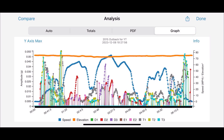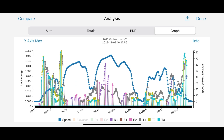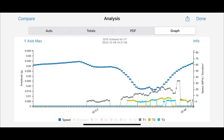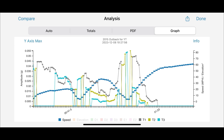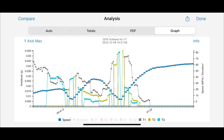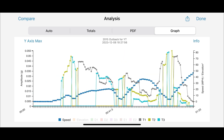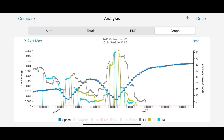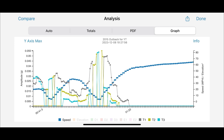If we rotate the phone sideways we can look at a graph. I like to deselect elevation, deselect the drivetrain, and deselect the engine — D and E stand for those — so I'm only looking at tires. Looking at the blue line which is our speed, you can definitely see the vibration increases as speed increases. It was even catching vibrations at 20 miles an hour, even though the customer said they could only feel them at 60 — that's how sensitive this device is.